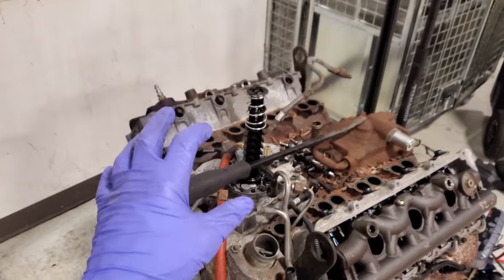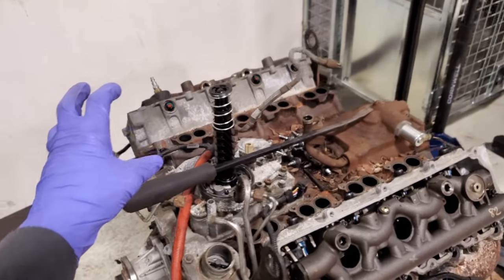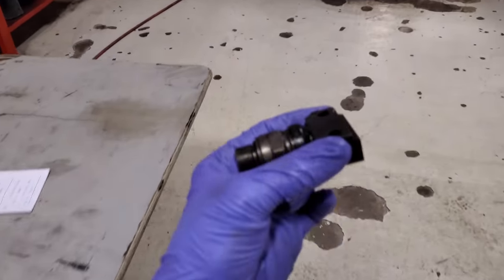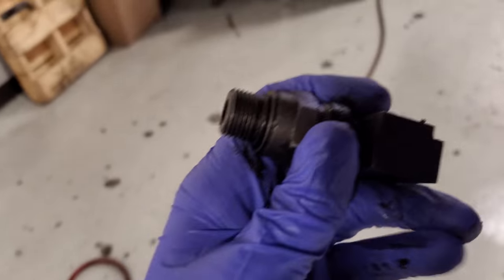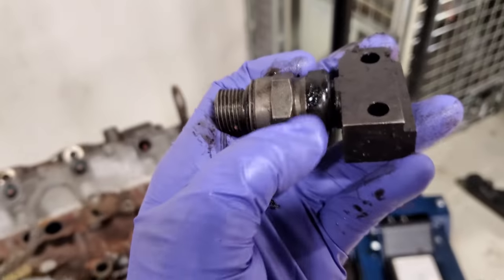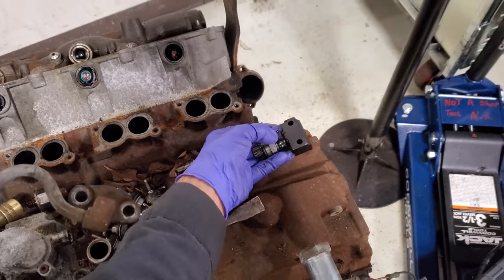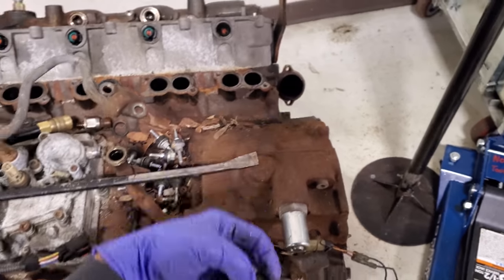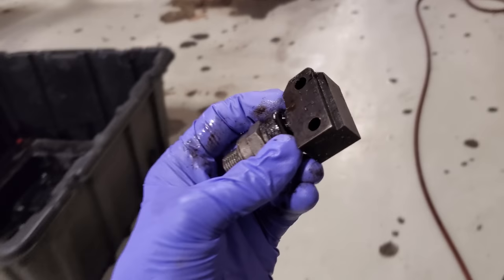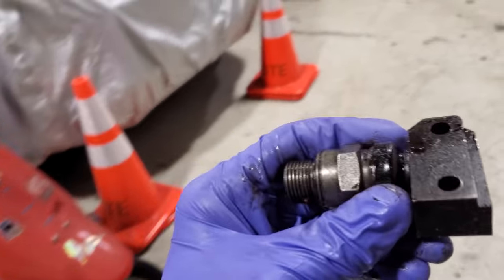I've mocked up my problem. When you start your air leak test, you first want to figure out what side of the engine the leak is coming from — driver's side or passenger's side. On '05 and up engines, I've also seen the snap-to-connect fitting from the pump to the branch tube fail. That fitting screws into the pump and can leak, so you need to isolate: is it passenger side, driver's side, or is it that fitting?